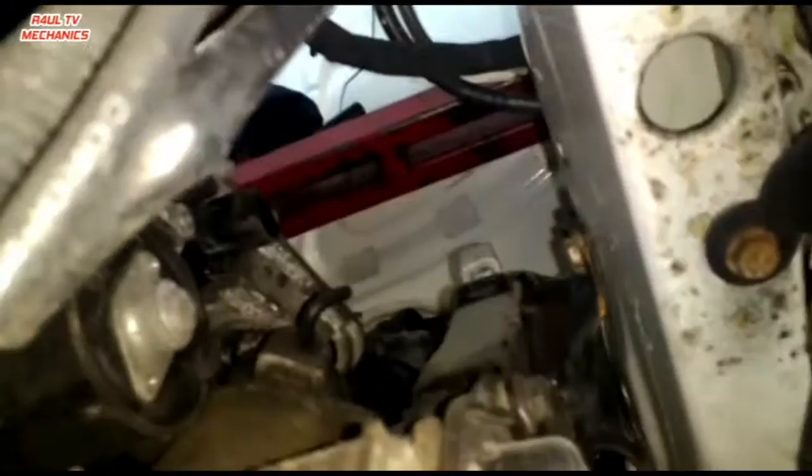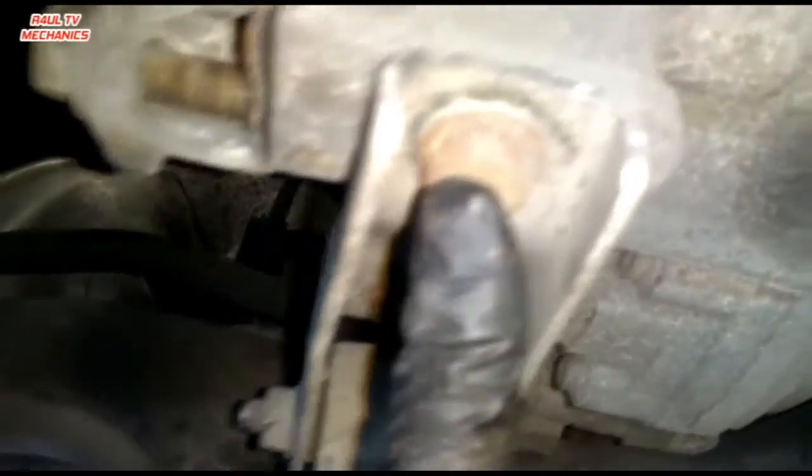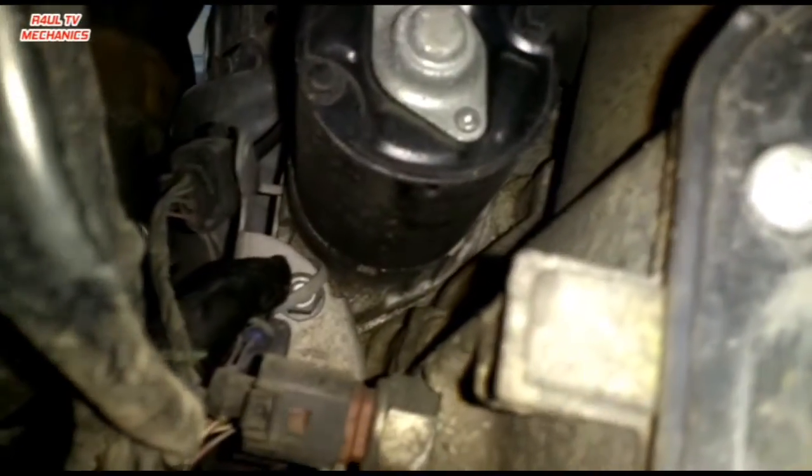Right, guys, I've set the car up on the ramp, as you can see here. The center, I've got the engine lifter on through there. What we're gonna do is, we can't get to them just yet, so we'll leave them for now. We'll take this center mounting bracket off. One bolt here, 16 mil, one there, one there, one there, and this one as well here on the back. Take that off. We'll take all the bellhousing bolts off besides this one. Take the starter bolt off, which is there behind that 13 mil.